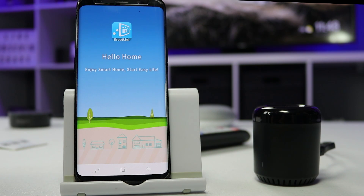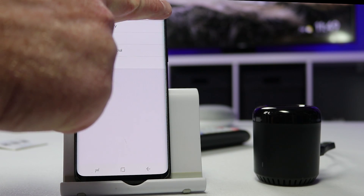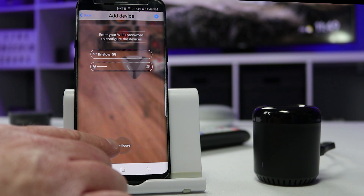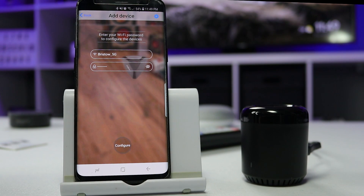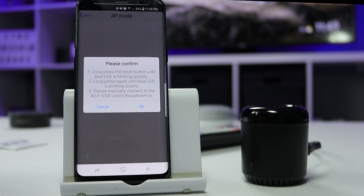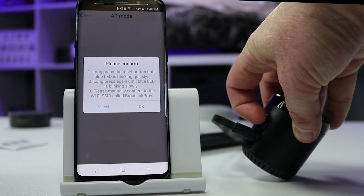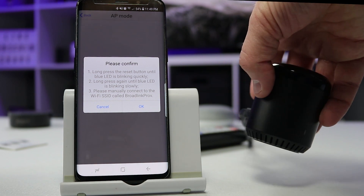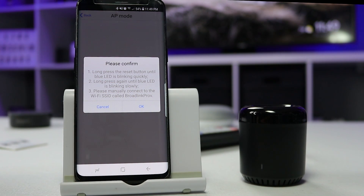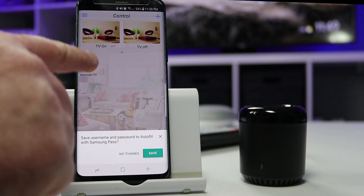The IHC app will help us add it to our smart devices so we can use voice commands. The first thing you need to do is connect this to your Wi-Fi. Go into the e-control application and select the plus to add a device. Type in your Wi-Fi and password, select configure, and plug in the device — it should be blinking a blue light. If you get a connection failed message, go into settings and use AP mode. Long press the reset button until the blue light flashes fast, then again until it does a slow flash. Then go into your Wi-Fi settings, select the Broadlink device, type in your Wi-Fi, and it paired seamlessly.